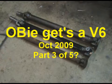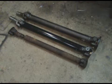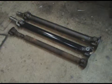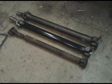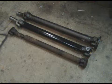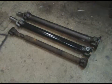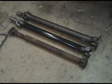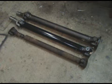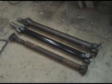Just got back from A1 Drive Shaft. I've gone up to let them shorten the shaft for the T5 transmission to meet the MGB rear. Figured I'd go ahead and have them shorten the narrowed Chevy rear that I have sitting here as well. The MG rear has a 390, the Chevy rear I got here is a 308. The large flange top shaft is the original Chevy unit that I put together way back — just had them shorten it to the length needed, in this case about 31 and 3/4 inches or so.